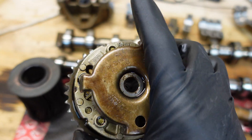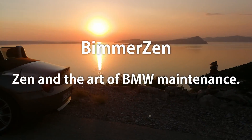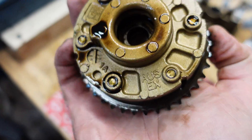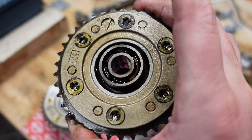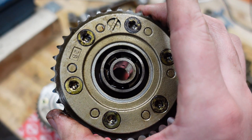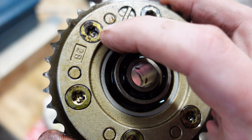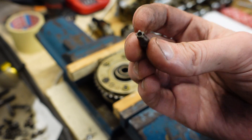I will have to open them up, inspect them, clean them out and see if they're still usable. Here is the exhaust side. As you can see, they are marked — never switch them around. In order to inspect this, you have to take it apart. But this is not a serviceable unit, so if you suspect you have a bad VANOS unit, you should just replace it. There is nothing of value inside — like in nuclear waste dumps. If you want to open it up, you will have to use 5-point torx bits. These bolts are kind of special.